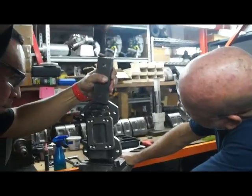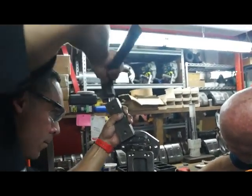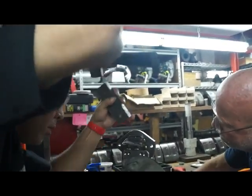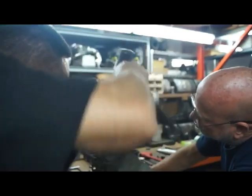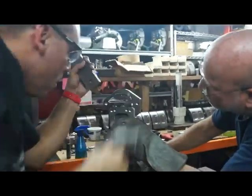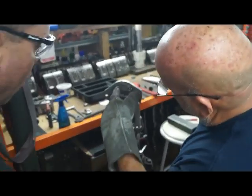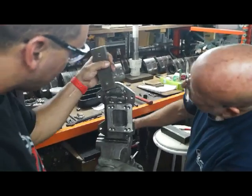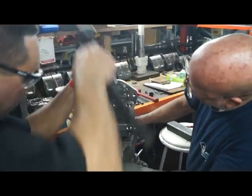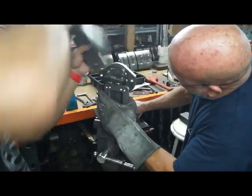So, let's get. I'm gonna get you close all around. Because what it'll do is angle the top of it more into the piece, but it's gonna want to open no matter what. Tack center, tack corner, and then pull. I'm gonna tack the center, and I could smash this half and then start on this half, and then we could come back and do that. Let's do that. That way, closer. Alright, that's good.